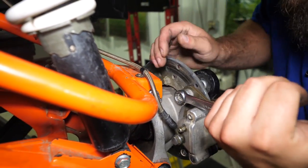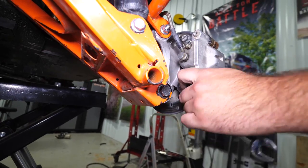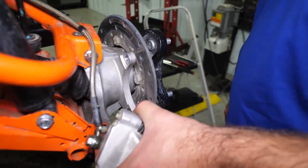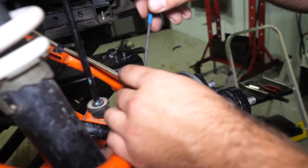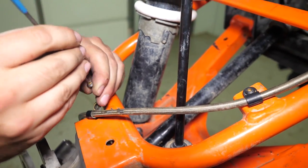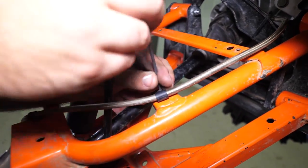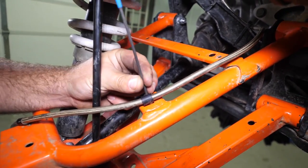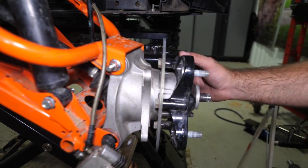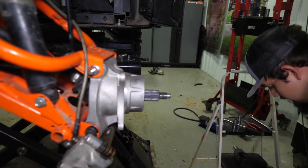Come in here and remove our brake caliper hardware. We'll slide our caliper off the rotor and start removing all of our brake line hardware. We may have different hardware than you since we've had our arms off before — that's fine, just remove any hardware securing the brake line to the A-arm. Then go ahead and remove our hub and set it aside.